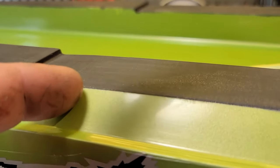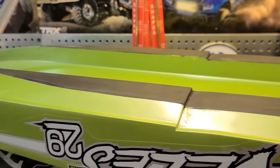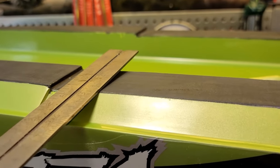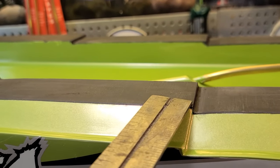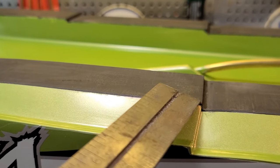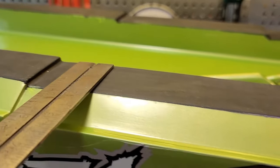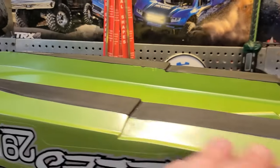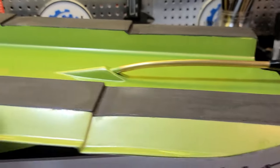I actually got quite a bit of graphite built up right here. If it don't ride or if I don't get the performance I'm looking for, I want to actually add a little bit of dead rise - sand a little bit of dead rise into my ride pad to nothing back here. Basically sand a little dead rise from nothing to the back of the step. That'll be something I do here and there - that's why I like to blueprint my boat, it's something for me to tinker around with.